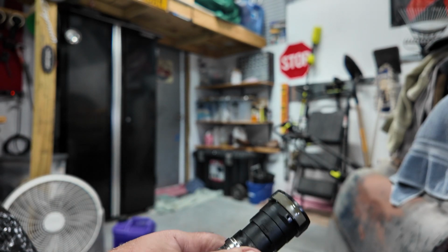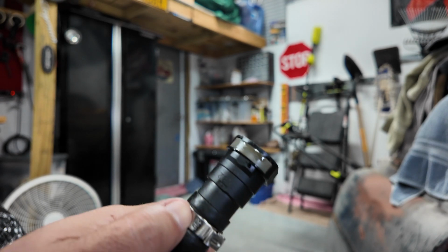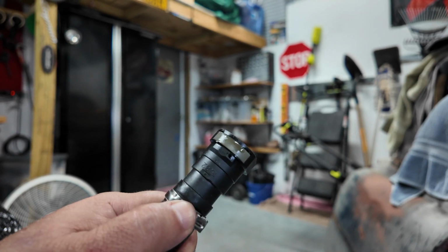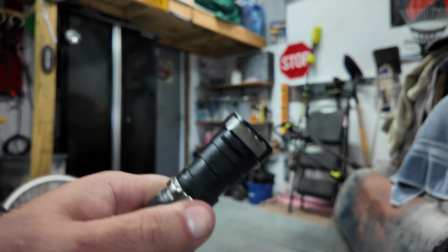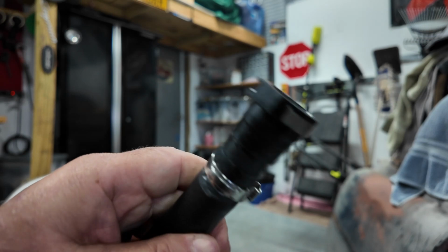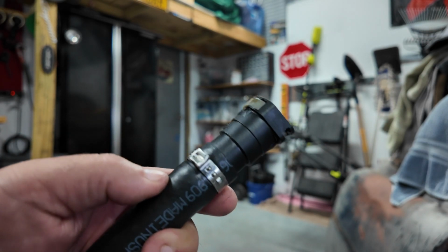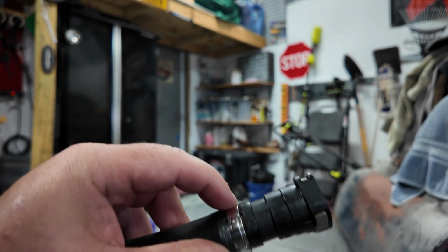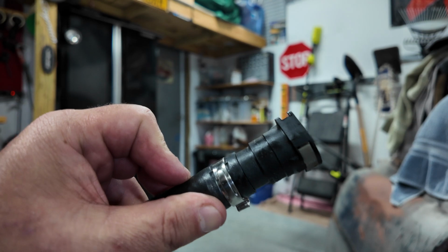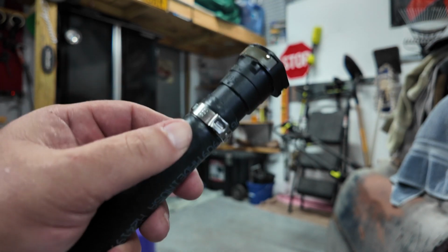And that's it. So you want to choose the ear hose clamp that's just barely bigger than the hose you're working on. So you can squeeze it down and it doesn't move. And again, it's just an OEM look and it spreads the clamping force more equally over the area and it doesn't cut into the hose like the worm style clamp does. I'm going to finish these up and show you the final.